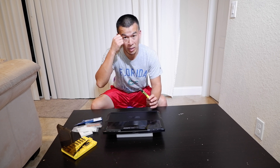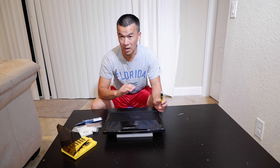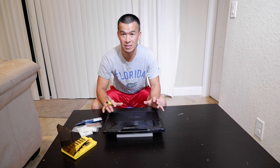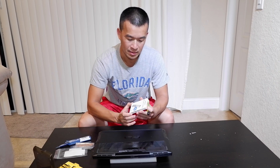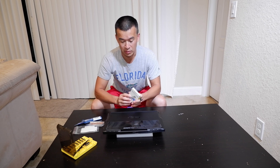In that previous video I tried to upgrade the SSD to a two-and-a-half-inch drive I had laying around, but to run a two-and-a-half-inch you actually can't run the M.2 drives on either of the ports — you'd need an adapter and it takes up all the room. The computer comes with an M.2 2230. Today I got this Sabrent Rocket Q — it's an M.2 2280, so it's going to fit in the second slot. It's one terabyte.